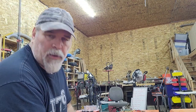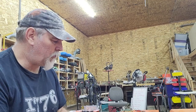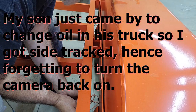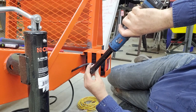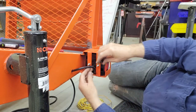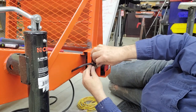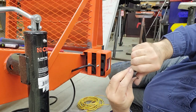I'm going to run a dedicated cable out to each axle connection. I put mounting studs for the wire clips down each cross member that was closest to the axle. So I'll just use one of the taillight mounting studs and put one small clamp on there. That way, in essence, if the cord ever got yanked on too hard, there'd be a little bit of support there. Probably won't, but it certainly doesn't hurt.